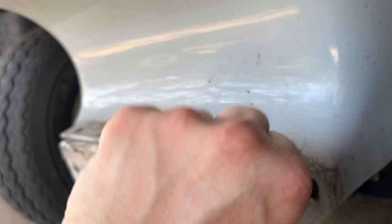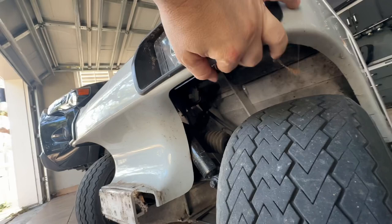Go wide here — you can see that thing just wants to fall off. I've got some headlights to unplug up in here. I'll get these unplugged — looks like the previous guy wire-tied them, so I'm going to clip the wire ties. The headlights are unclipped now. Let's just lift that off of there.